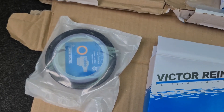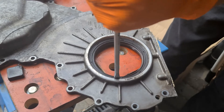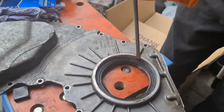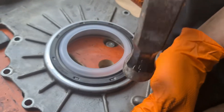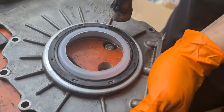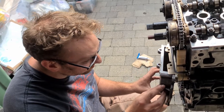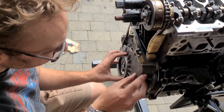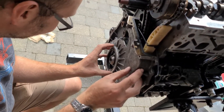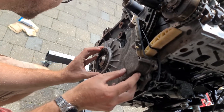Next to replace is the crankshaft seal. To remove it there's no real easy or delicate way — you just have to use a screwdriver and tap it out with a hammer, being extra careful not to catch the aluminium since the screwdriver is tougher than the alloy. To fit the new seal, mount it from the front and tap it in gently with a hammer until it's flush. Unfortunately, by removing the plastic insert from the crankshaft seal it wouldn't seat correctly on the shaft — it splayed out and would leak. That put paid to any more engine rebuilding because I need a new seal and there's a long lead time.